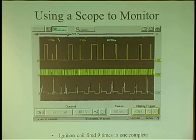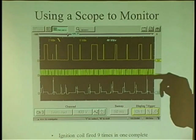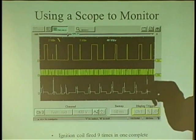But here's the thing about these sensors, where they're located. It's a very bad environment. Who's right above them on the second floor while they're down here? The little spark jumping around up there? That's secondary voltage, which creates electromagnetic interference. You imagine being down there working, doing your job, going, oh my God, the dude on the second floor, he's dangerous. So what happens is, if you have a bad plug wire, and the spark can't go in the cylinder, I mean, look, I'm spark, and I'm going, okay, I'm going to go through the wire, no problem, I'm cool with that. Now I'm going to jump the spark plug gap, but dude, it's hot in there.